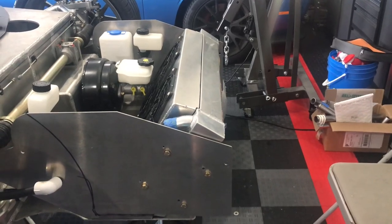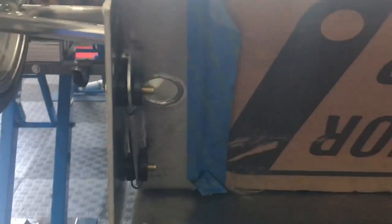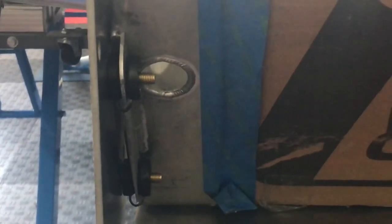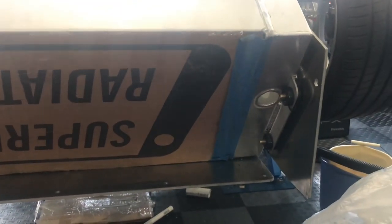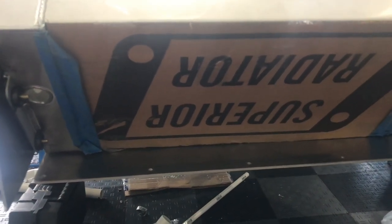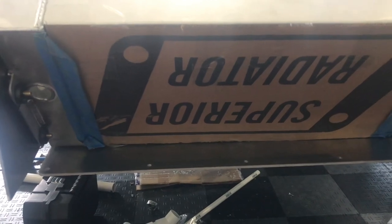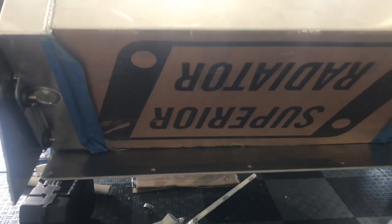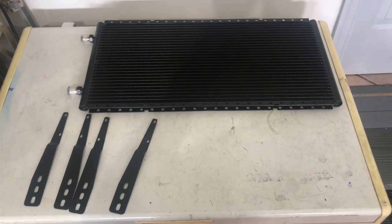Here's a view of the front of the radiator. If I zoom in you can see the front radiator brackets, the 3/8 inch bolts, and the grommet assembly and how it all goes together. You'll also notice a hole through the radiator on both sides — these holes are there so you can route the number eight and number six condenser lines. The number eight goes to the compressor, the number six goes to the dryer. In this video we're really just focused on how we're going to mount the condenser, not the AC line routing — we'll cover that in a follow-on video.